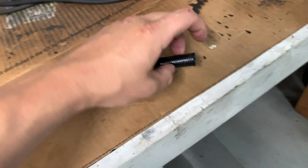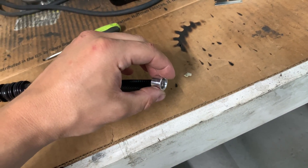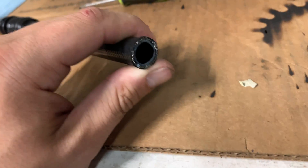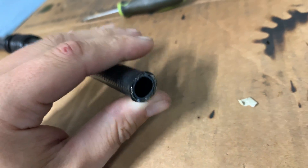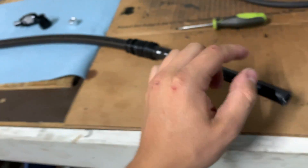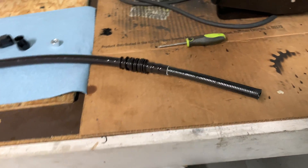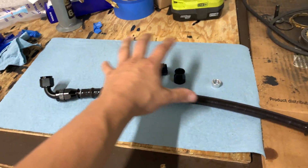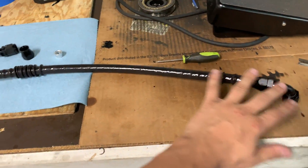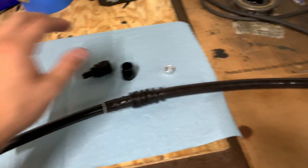Once that's cut off, I can start peeling back the stainless using a little flathead screwdriver, then slide the fitting onto the PTFE tube. This PTFE tube has an inner liner to stop static electricity from building up and causing the fuel to combust. It has the PTFE tube, a stainless liner, a Hystrix liner, and I also have a fiberglass silicone liner that's good for 300°F — and the Hystrix liner is good for 300°F as well. Tons of protection here. Assembling on a fairly clean surface, because you don't want to get debris in here. Once this is assembled, I'm going to clean it all out with one of those fish tank swab things.